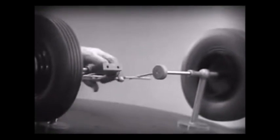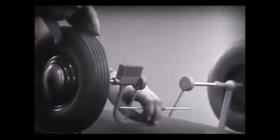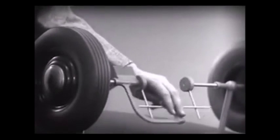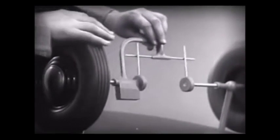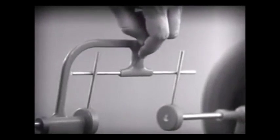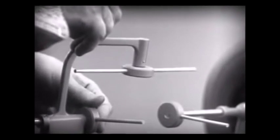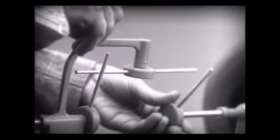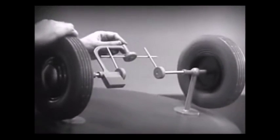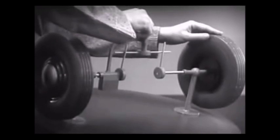But let's see what happens when we go around a corner. With this arrangement, we cannot drive one wheel faster than the other. And if we stop one wheel, the other wheel won't budge. Let's put this bar on a pivot so that it can swing in either direction. Now the bar can still turn both wheels at the same speed, and because it pivots, it lets one wheel turn even when the other is stopped.